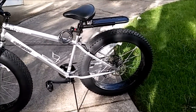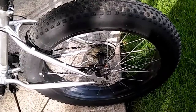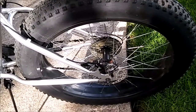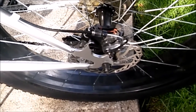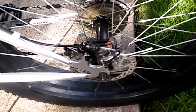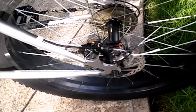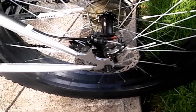Let's start with the brakes. As I mentioned in the previous video, the brakes are pretty much fixed since I aligned them based off a YouTube video that tells you how to align mechanical disc brakes, so you don't hear that squeaky noise they normally make when new because they aren't perfectly aligned. I had to adjust the cables probably every three weeks to every month, since the cable stretches a little bit, to keep the same feel on the handle grips.